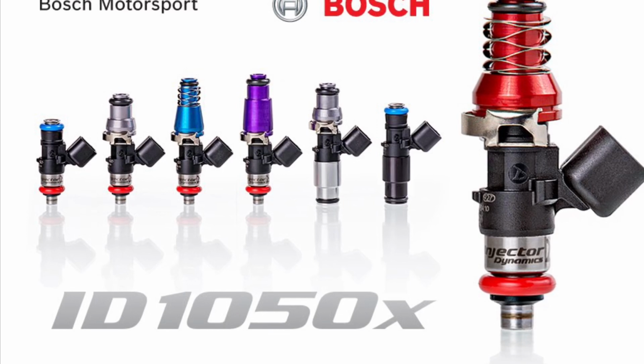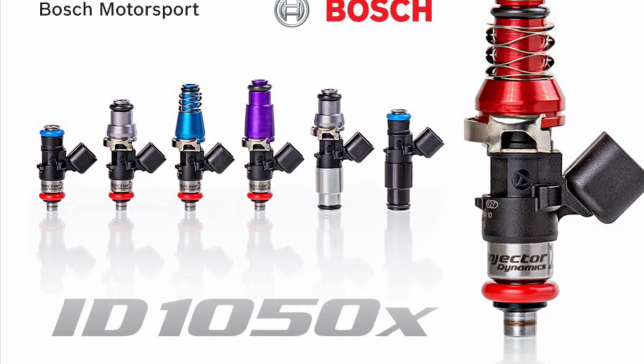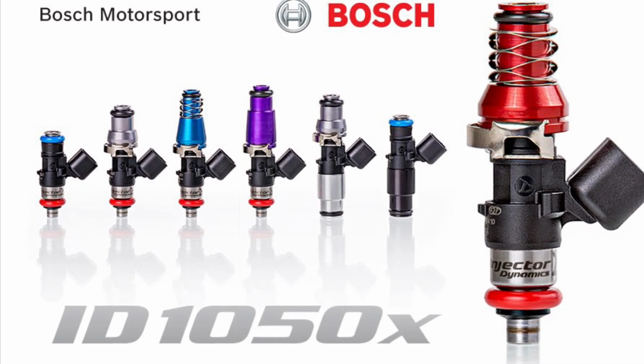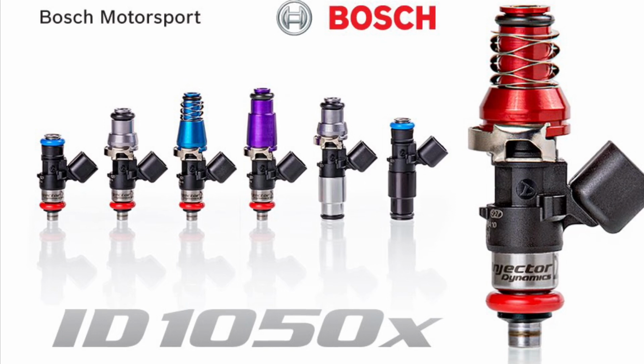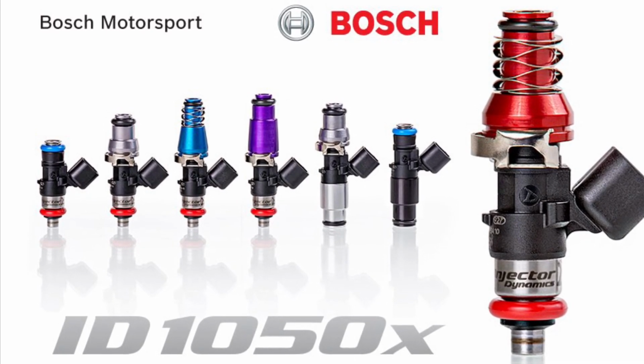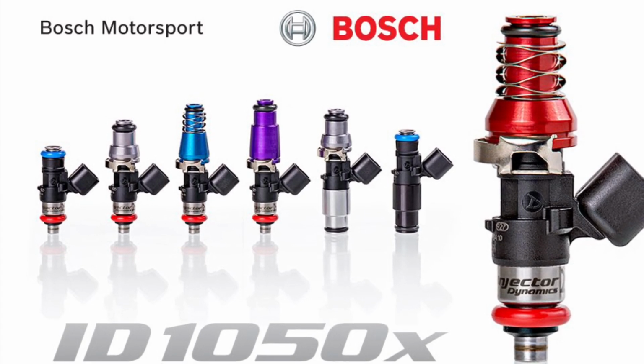Yeah. ID1050 injectors run a lot more than your normal Deca 80s or other 80-pound injectors. They're probably closer to 110-pound injectors. So especially once I start adding E85, it's still going to be able to handle different types of fuel as I change things up. The Walbro 485 is not a direct drop-in.